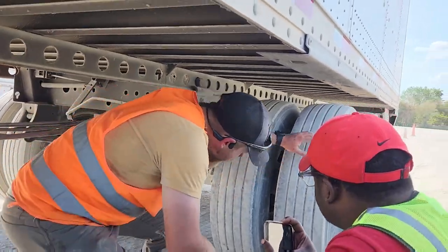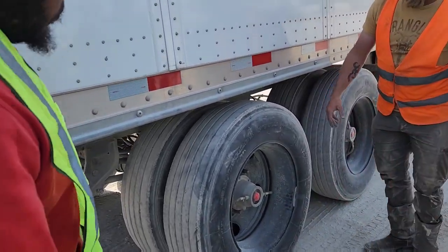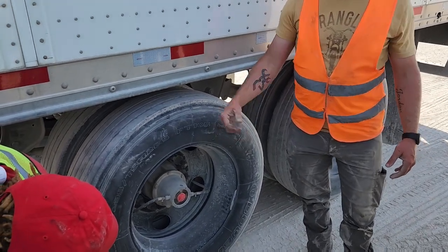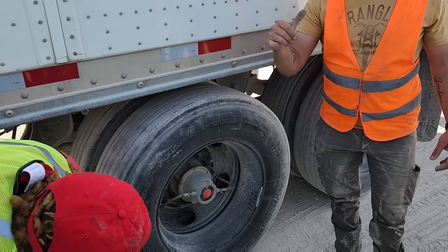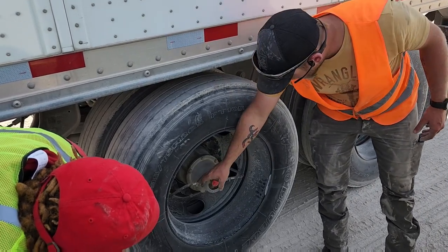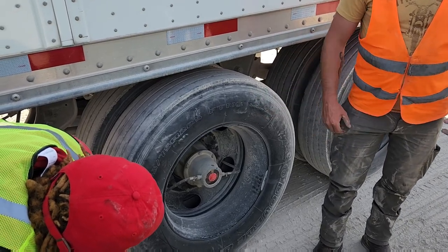So, again, you'll come out here. Now, some of y'all are probably looking at this going, what is this contraption, right? All of Pam's trailers have an auto inflate system for their trailer tires. So when you hook up and you release the red emergency valve, it starts feeding air to this whole system. And in the process of that, it starts shooting air into all your tires up to 100 PSI. Make sure they're not flat. That is on all of them.